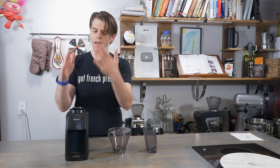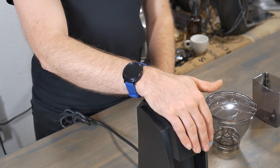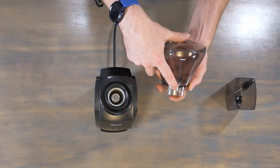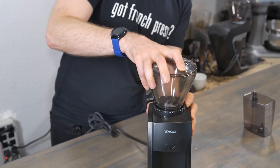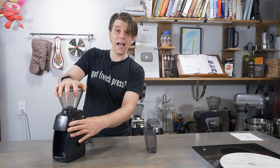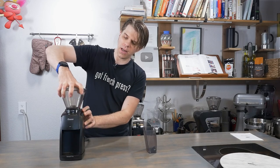One thing to mention: when this gasket is new, even if you stretch it and place it, it'll have a tendency to start sliding up. Just hold it down for a few moments, press down. As long as it stays in place, take your bean hopper, white line right there, pop it down at just past the 40 mark — there's a little arrow just past 40, line it up with that, press down a little bit and turn. You've got to give it a little press to get it down because that gasket makes a really good seal. That gasket makes sure that coffee grounds don't fly everywhere and keeps things clean. So it's doing its job if you have to press down a little bit and then turn.